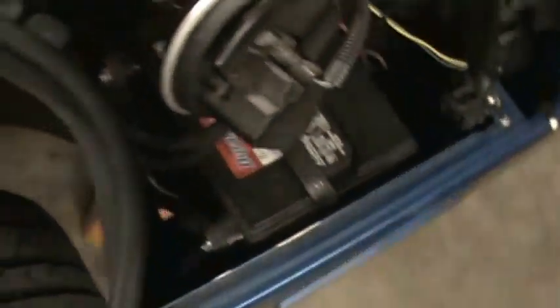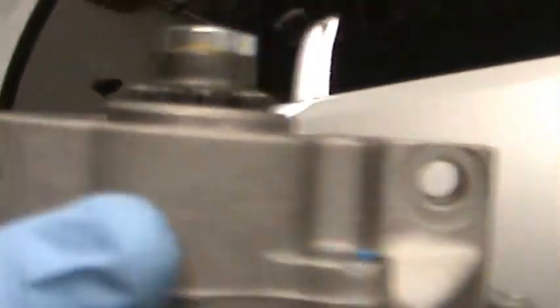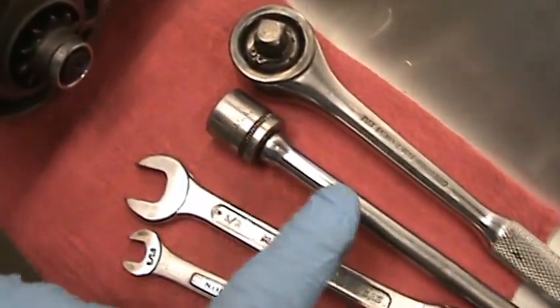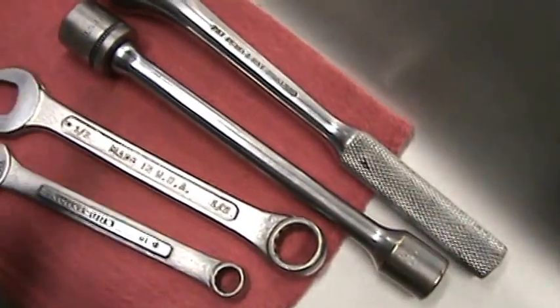I also pop the hood before I jack it up. Now what my plan is, I'm going to disconnect the positive battery connector. Come over here — this is the new starter. There's two bolt holes: that one and that one. My car uses a nine-sixteenths socket for those, and I'm going to use an extension and a ratchet of course.